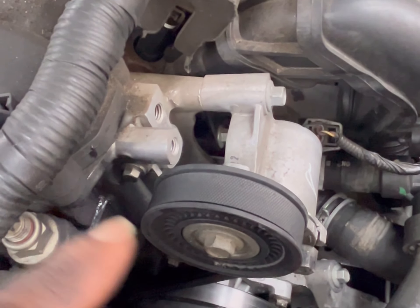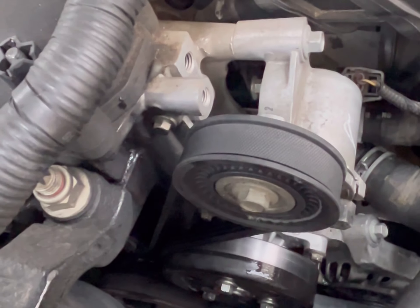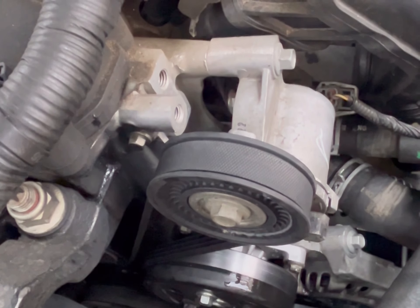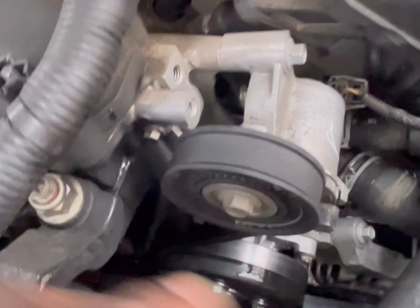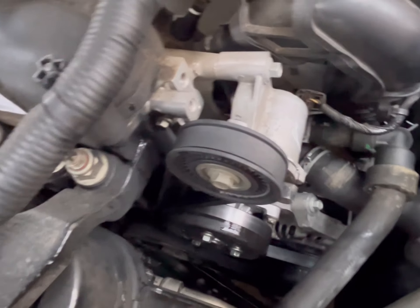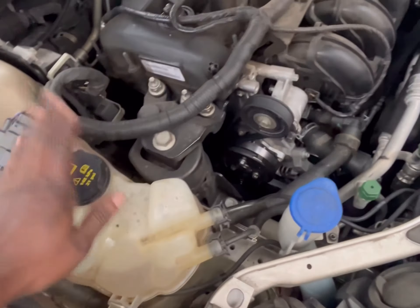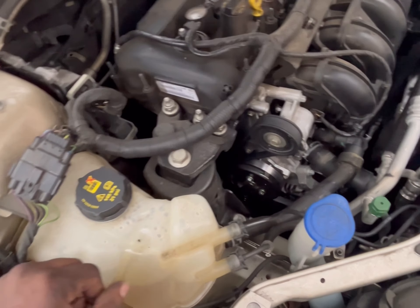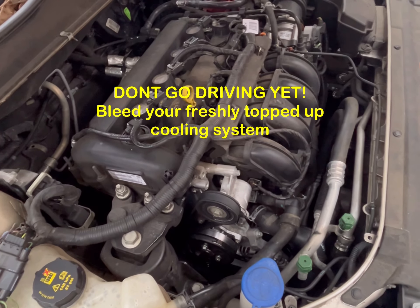There we go — after the pulley's back on, you route the drive belt. Here's a belt orientation picture for those who need it — I'll post that somewhere on screen. Pretty straightforward, nothing crazy, and you don't really have to even get under the car like a lot of tutorials suggest. Make sure you fill the coolant back up, give it a start, and you should be good to go.